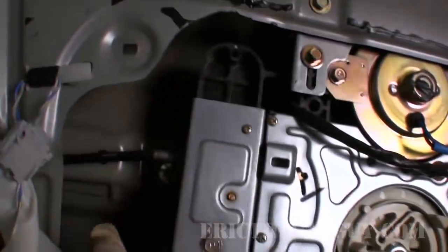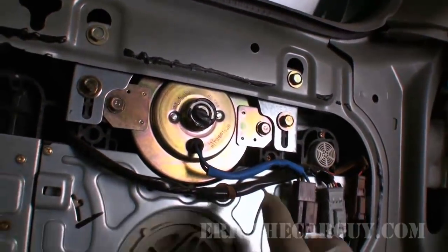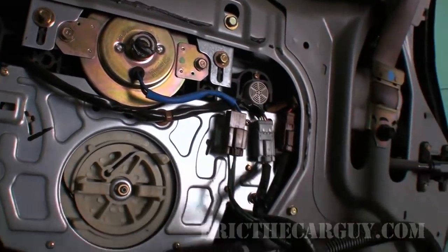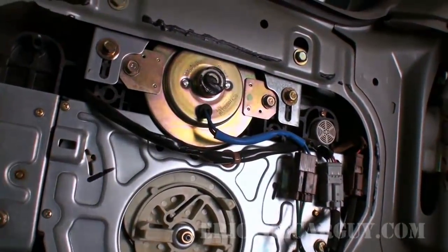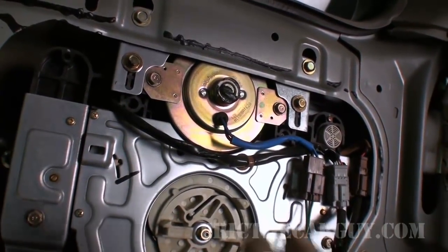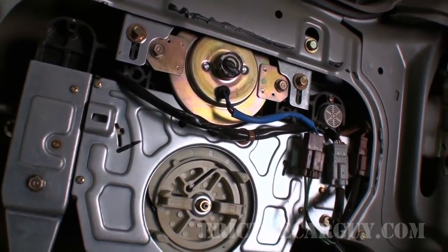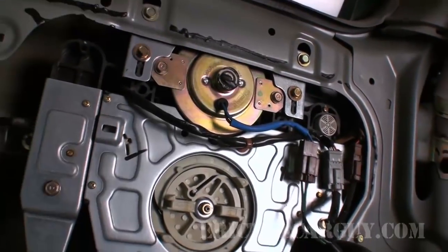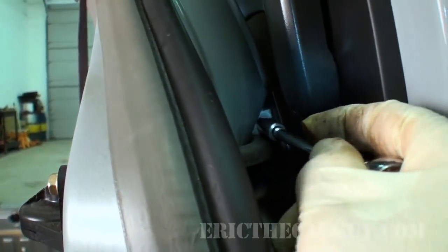This is a cable operator — there's a cable that runs through on this side and a cable on that side, and there's one motor that does it all. There's also a control unit integrated into this that whenever it gets a command from the switch on the dash, the button you push, or the handle on the door, it basically tells this motor to activate. It also has a speed sensor feature: if the door is closing and that speed sensor senses a significant change in speed, it will stop the door from closing — basically to try to protect you from squishing somebody or something.